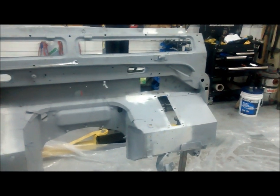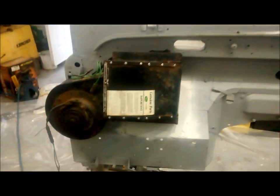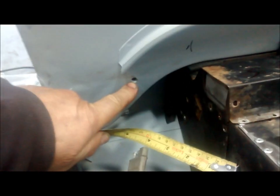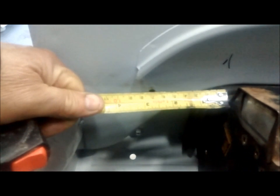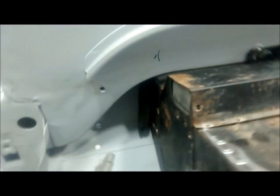The bulkhead is now all primed up, patched up and reprimed. It's time to work out where the heater box is going to go. I've converted this from a right-hand drive to a left-hand drive. A key note: this stud here should be around about six and a half centimeters from the edge of the box — then you know it's going to fit. On the right-hand drive these studs don't line up. I've put a couple of tek screws in for now but I'm going to make a better bracket.